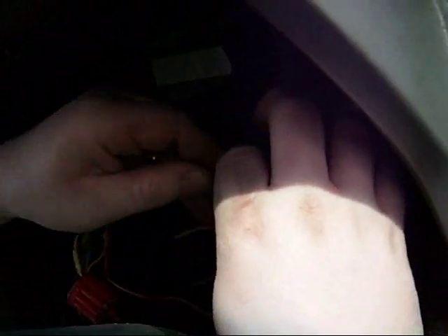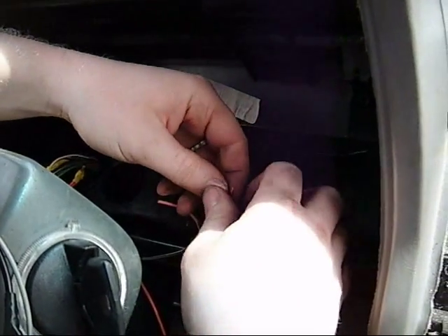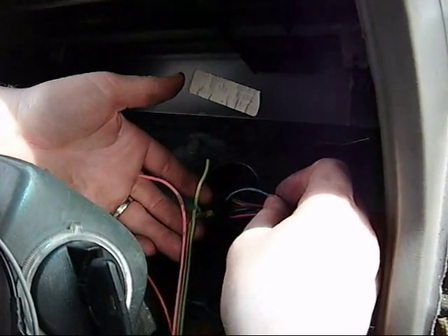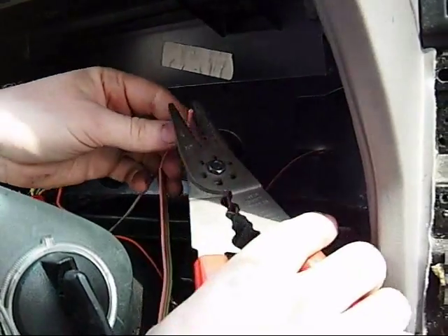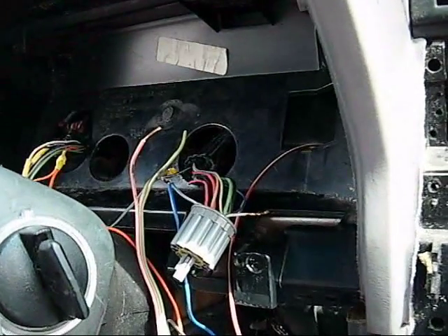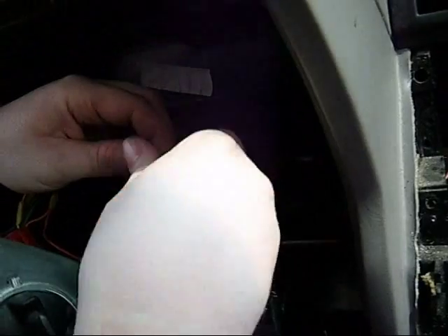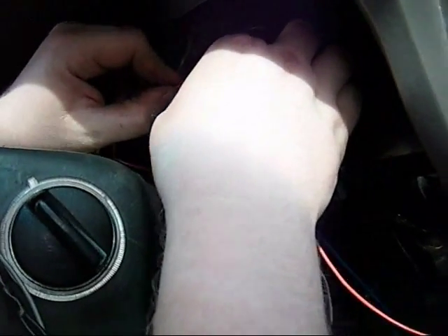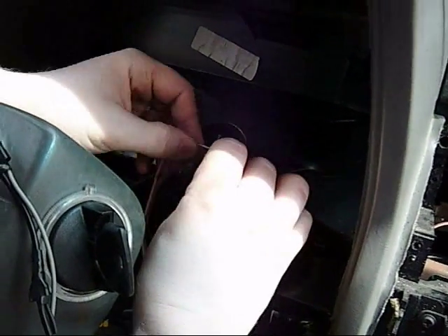In this case, I'm actually gonna be hooking two wires under the same wire. They're both pretty low voltage applications. But for his aftermarket tachometer — when we eventually do that anyways — I'm gonna save myself a hassle right now and do it at the same time. Give it about a half inch strip of coating, that's about all you need. Twist them together. Feed it through the same hole.